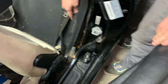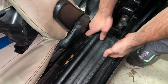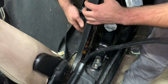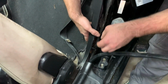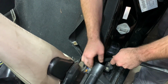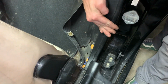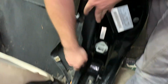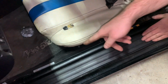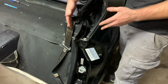All right, we'll open the door a little bit. This panel under here gets tucked under here. So these are just little tabs that you can kind of pull up. And then back here you have this guide. It'll guide you in this hole back here, and then clip into place. And then make sure your weather seal is above both of them, and then push it down according to height. This guy, I need to tuck that carpet in too. And that's the inner side of the panel.